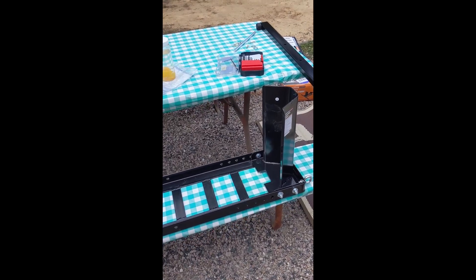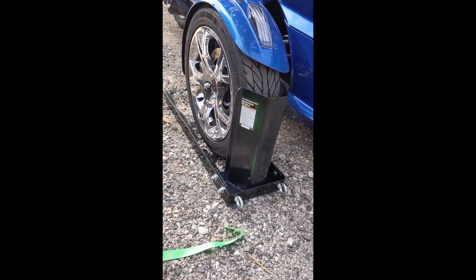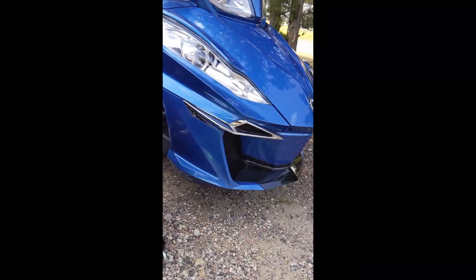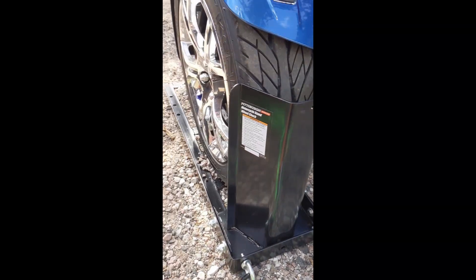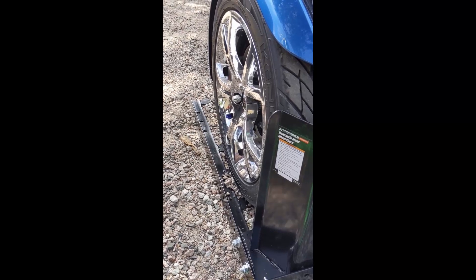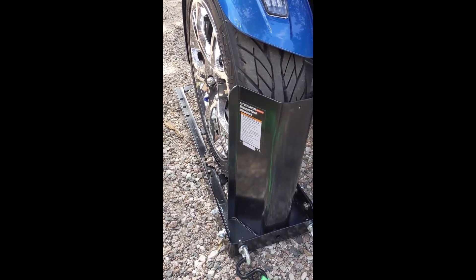I will show you the bike on the ground and then once I've got it mounted in the garage itself. I'm going to show you on the outside of the garage before I bolt this in place — this is how it's going to hold the tire. I'll have a second one on the other side. I'll take a ratchet strap and run it through these hooks that came with them, run around the tire, and ratchet back over to this pivot point. That's going to hold the tire snug against here and keep my front end secure. This frame is going to be bolted, which makes it very secure, and in the back I'll use the factory tie downs that Riverstone added to the unit to keep the rear tire from shifting, which should alleviate my issues of the bike dancing around inside the garage.